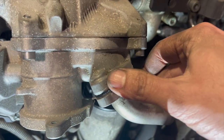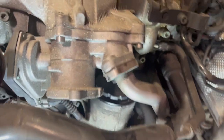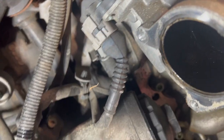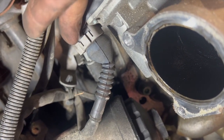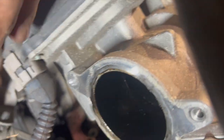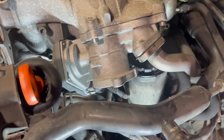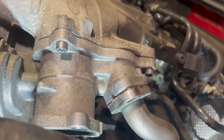I've got the two bolts out and the gasket's stayed quite well stuck on the pipe, so I'm not going to disturb it. Next, there's a connector on the EGR — same style as the throttle body — so we just flick the connector off and then undo all the main bolts for the EGR housing. Most of them are fairly accessible. One of the bolts we already took out was the long one. You want a Torx 30 socket for them.